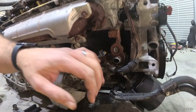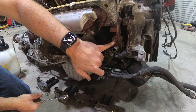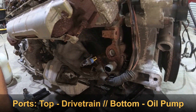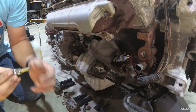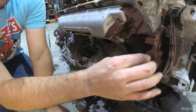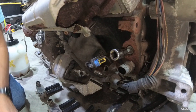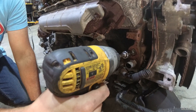Now we're going to look at the two bosses. One is routed directly up to the valve train, whereas the other is more towards the oil pump. I like to work with both of them. We'll take an eight millimeter hex key — most people call it an Allen — and fit it into the three-eighths NPT plug. Go ahead and take the plug out.